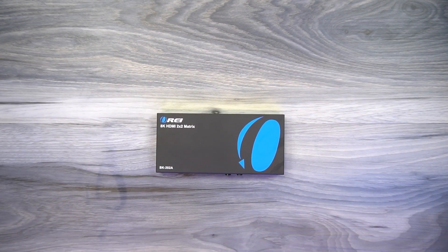Now I'll do a quick demonstration to show you just how simple this product will be to use with your own equipment. I've set up two small media players — one is looping a video of some recent drone footage, and the other has an image of a game console, just to make them easy to tell apart. Over here I've set up two monitors representing the output devices. I have the 2x2 8K HDMI matrix in front of me. I'll plug the two HDMI cables from my media devices into HDMI input one and input two, then connect the monitor cables to HDMI output one and output two.